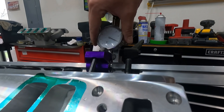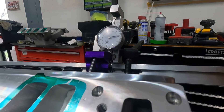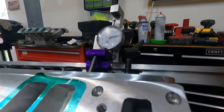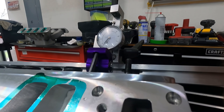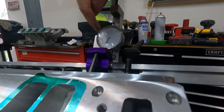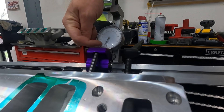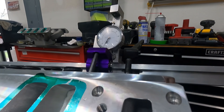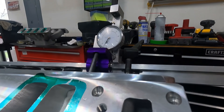Let me show you the math before we measure. With the check spring, we had 587 lift with the Comp rocker. For the Speedway 1.3 rocker, take the lobe times 1.3 and it should be 468 lift. But let's see what we actually get. Back to zero — spinning it over. One, two, three, four. So this one would be 400, and it's at 30, which means 70, so we get 475 lift. We've got more than the advertised 468.